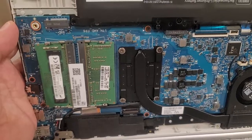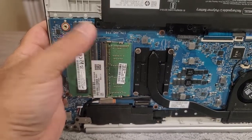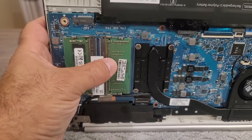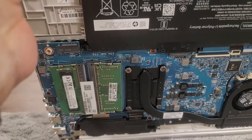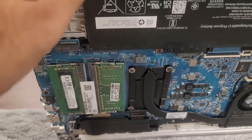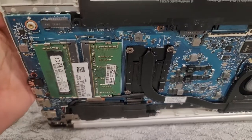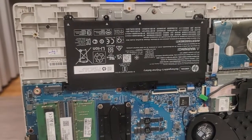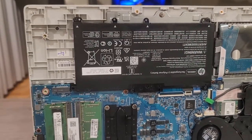So this is the answer to our question: yes, this laptop is upgradable. We can upgrade the memory from 12GB to 16GB — just remove the 4GB RAM and put in an 8GB stick on the same DDR4 3200 bus. It's about $50 and you can get one from Amazon or any online or in-store market. For the hard drive, you can use 512GB or one terabyte — I wouldn't recommend anything less than 512GB.